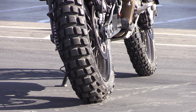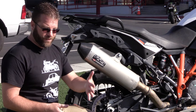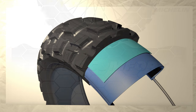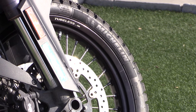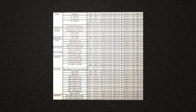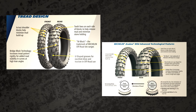When it first came to market, it came in four specific tire sizes — for the oil-cooled and liquid-cooled R1200GSs. Those two motorcycles are the heaviest and some of the more powerful adventure bikes on the market, so it was the perfect place to start. Those are radial tires, and part of the reason for the radial tire is to dissipate heat better. The more you can lower the temperature of the tire, the more longevity you'll get. We now have over 36 different options in a mix of bias and radial ply tires to fit just about anything that can go on and off-road. Michelin believes they've developed the perfect 50-50 tire, and today we're going to put it to the test.